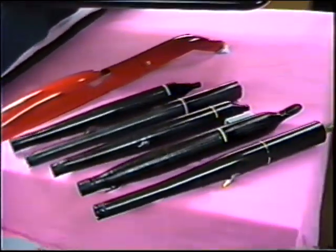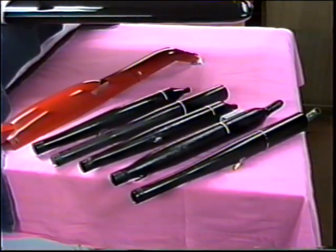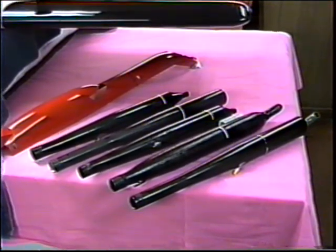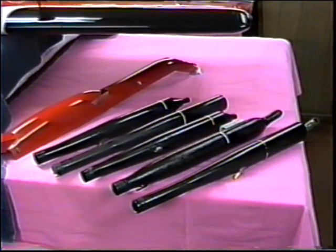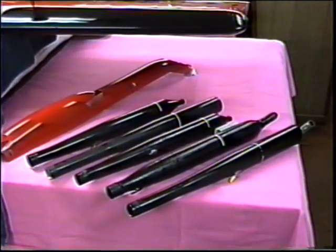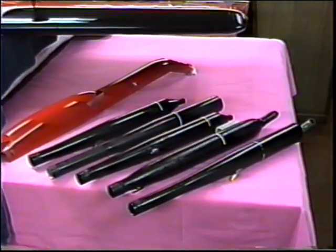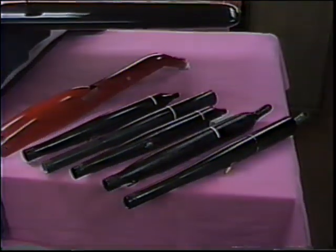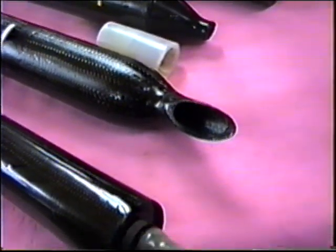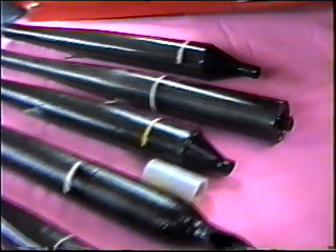See, the whole trick with pipes is over the years, what happened in 1991 was we had come up with a pipe dimension that was much larger than what people were using, and since then their pipes have gotten a little bit bigger, which is good. And nobody's trying to take any credit for any of this, but the volume of the pipe, just like the Yamaha development program, the volume has gotten bigger over the years. The more volume you seem to have, the better it runs. Also experimented with much larger outlet diameters, some with flat baffles, some with conical 20-degree baffles.